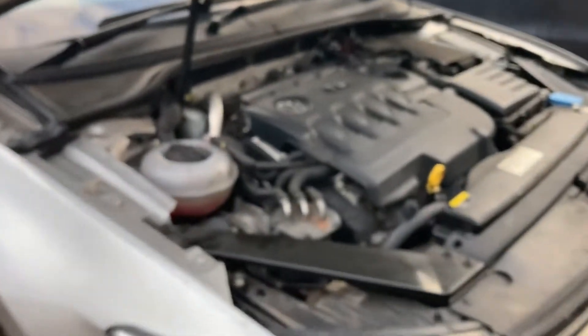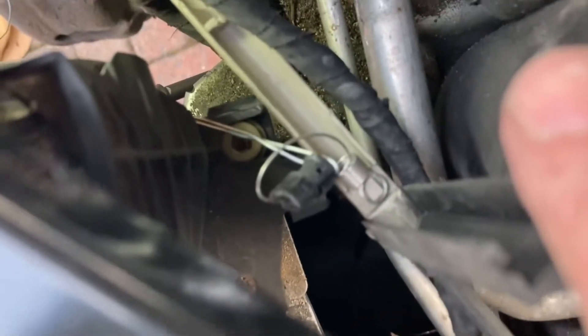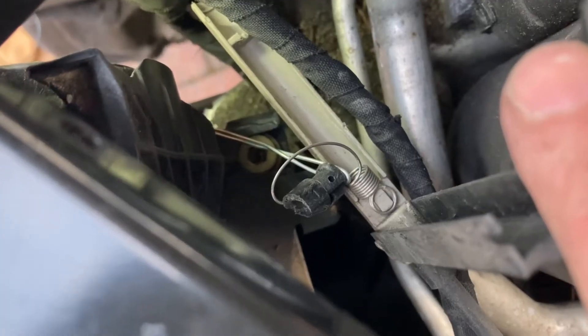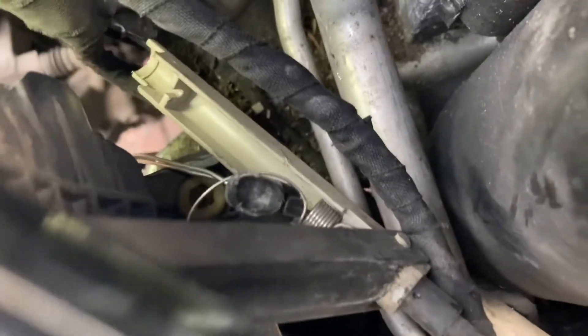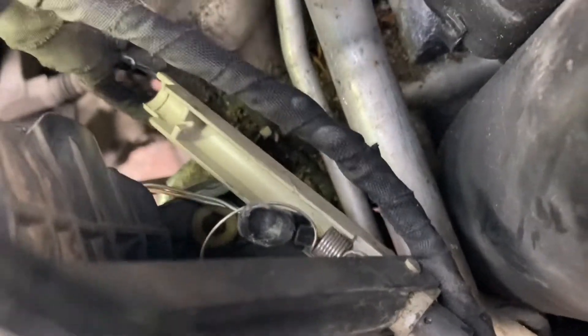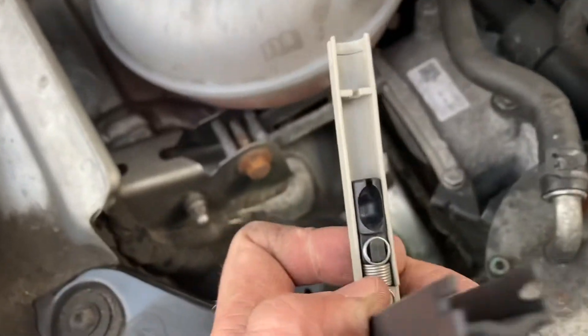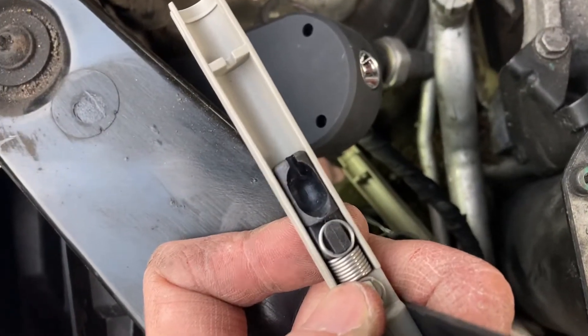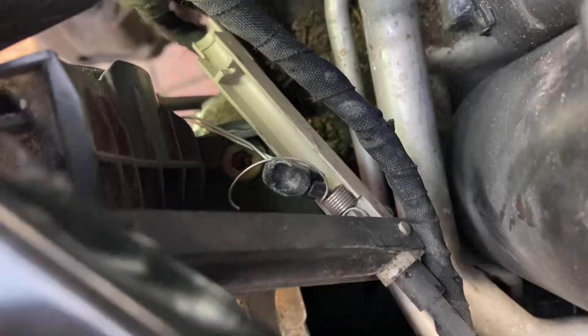Finally open, and you'll be able to see the problem. Trying to pull that with a tool is very difficult, and the plastic piece here — that socket is shattered. Let me show you the new one I'm replacing it with. That's the socket that the ball fits in, and that's the shattered one.